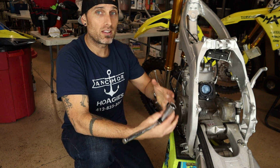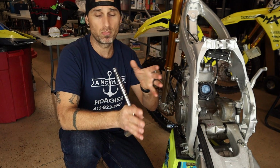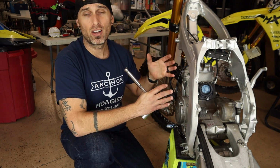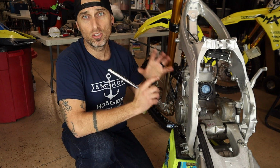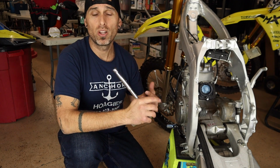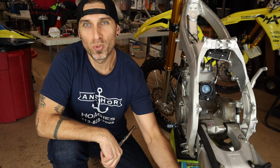Now I know that the front of the engine, where those engine mounts are going to be, everything should be square. Everything should be kind of where it needs to be, and that will help me gauge the front end and figure out how far off the mounts are, because I would like to make a bracket that would hold the 250 engine into this 250Z frame and not have to do as much cutting and welding, but we'll see how it goes. At any rate, I think this is the important first step. Super cool to get that out of the way.